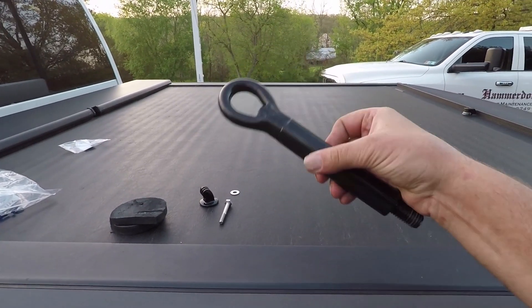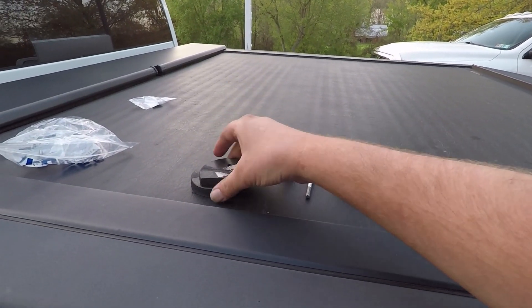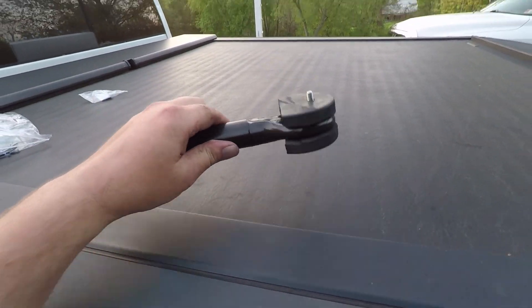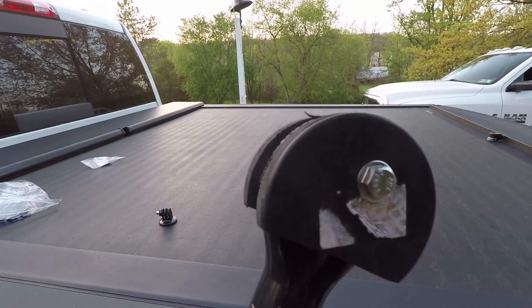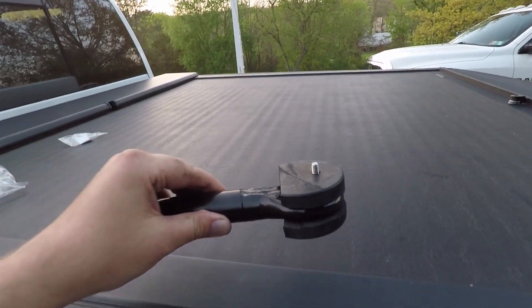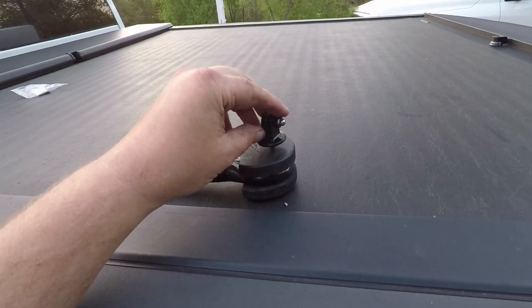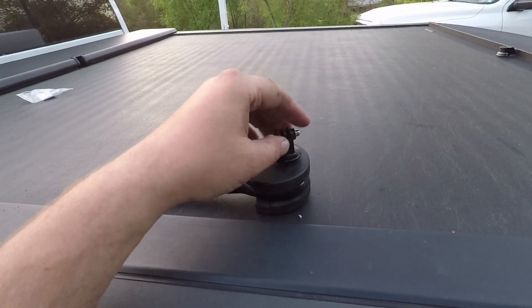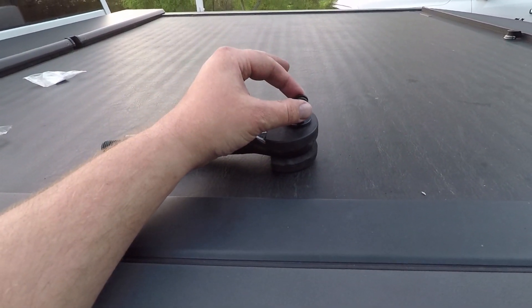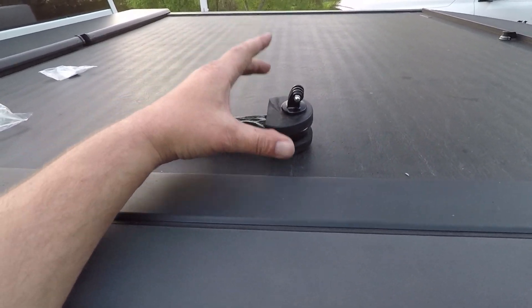Here I have my factory tow hook — keeping in mind that not everybody has a tow hook for their Camaro. We're going to put our two halves together with our bolt and camera mount and show you the finished product. I pushed the bolt through the hole we drilled with the washer on the back side, which gives you a stud sticking out the top. Then we take our camera mount and thread that right onto there to hold it all in place. Since this is rubber, you're actually able to tighten it down fairly tightly — it's going to suck down into the hole of your tow hook and it's not going to be able to come loose.